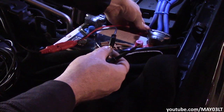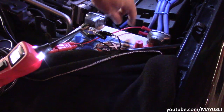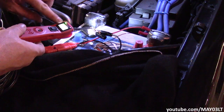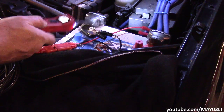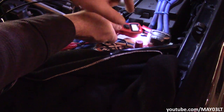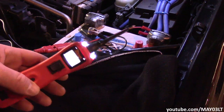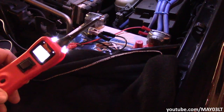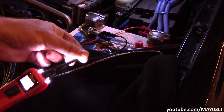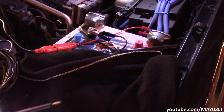Just in case someone who hasn't seen that video wants a little demonstration — pretty much positive on the red, negative on the black. If it finds ground, it lights up the negative symbol here, and it also has a beeper. If you touch positive, you're going to see a red plus indicator light up, and this one also displays voltage. The only problem with this tool — if you just had a single strand of copper coming off the negative battery terminal and you touched it on this test light, it will light up green and look like a good ground. Try to run four amps through that little single strand of copper and tell me how you make out.